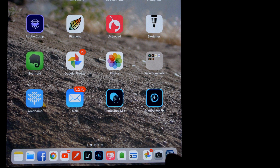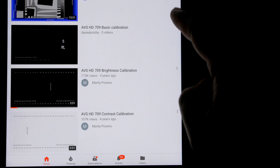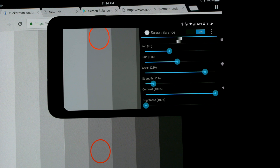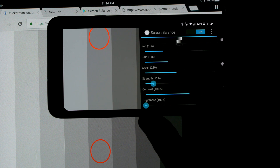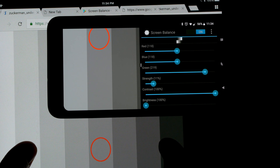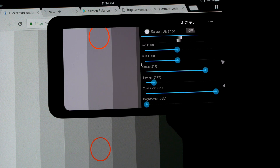I have all of my settings below in the description. For fun, I wanted to see if I could use this app to emulate some of the screens I had lying around. I have a 9.7 inch iPad Pro with a Retina IPS display. This is using LCD technology, so it can't display true blacks like the OLED, but Apple's color calibration has always been excellent. When using the iPad Pro as my reference screen, I made sure to turn the brightness to max, night shift off, auto brightness off, and true tone off. I used 18% gray as my white balancing point of reference — also called middle gray, which is perceptually halfway between black and white on a lightness scale. I eyeballed the red, green, and blue values, so I'm sure someone else could do a better job if they spent more time or used a calibration spider. Also, keep in mind that screens can have variations, so what works well on mine may not be perfect on yours.